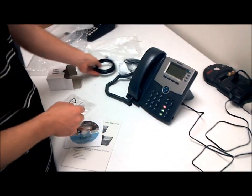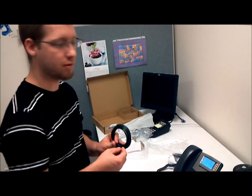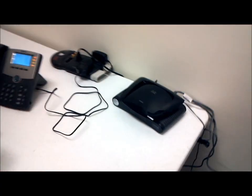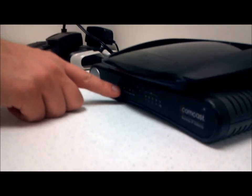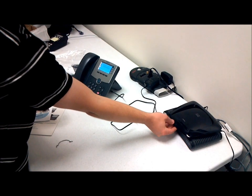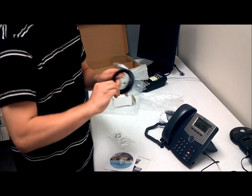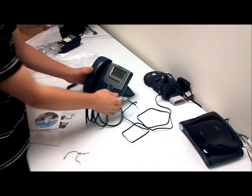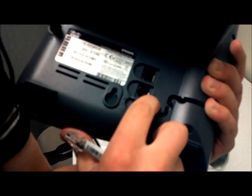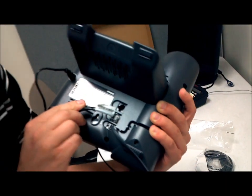The next step is we're going to want to connect it up to your internet connection, because these phones work over the internet. I'm going to go ahead and use the smaller cable because the phone is close to my modem and router. You should have a very similar setup at your home. Plug in your ethernet cable to the back of your phone first. The plug you're going to want to use is the one that says SW — one says PC and the other says SW. You want to use SW, which stands for switch. Plug it into that port there.